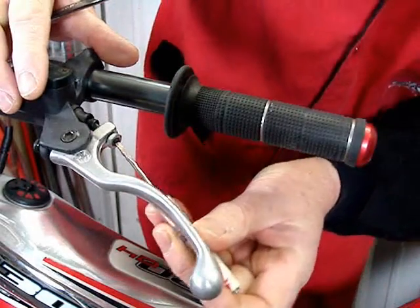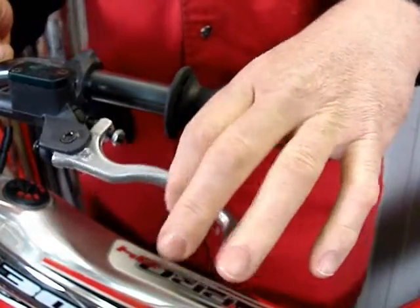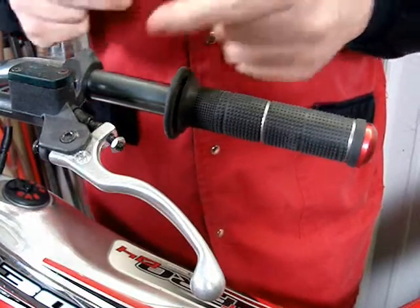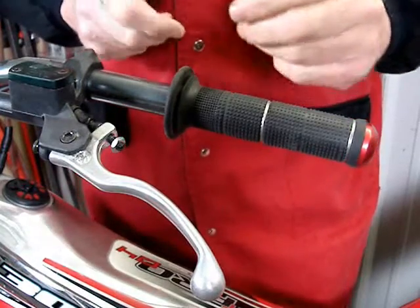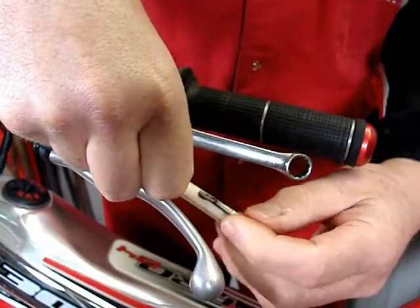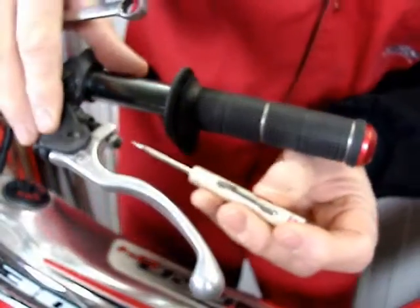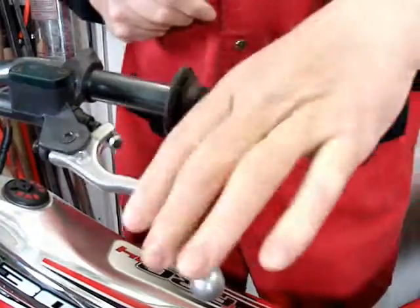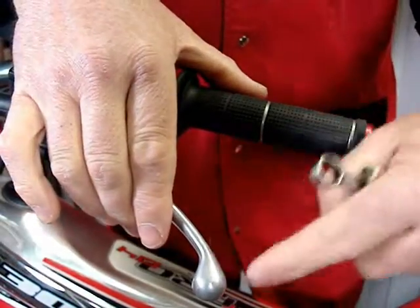When you take this screw out too far, you have excessive free play and you don't have a complete movement of the piston in the bore — it's not going all the way to the end of the bore, so therefore not moving its entire amount of fluid. Ideally you have this set up so the preload on the push pin between the piston and the lever allows you just a little bit of free play, and then you get the full stroke of the piston which moves the maximum amount of fluid through the system, with the lever coming all the way to the grip.